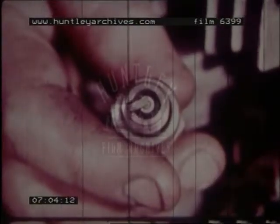Check the spark plug. The plug points should be free from oil and carbon, and the gap between the points should not be too wide. If necessary, have the plug cleaned and reset the point gap according to the handbook. Don't forget to check the plug washer. Make sure the plug is tightened firmly back into the cylinder head and the ignition lead securely replaced.